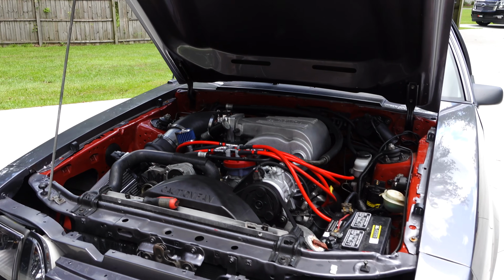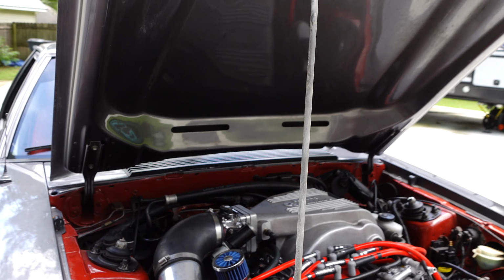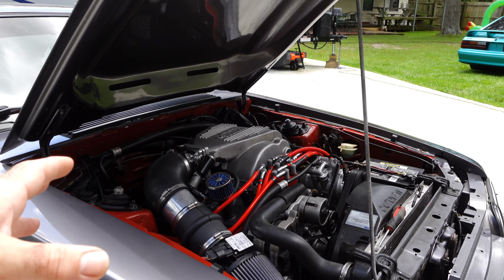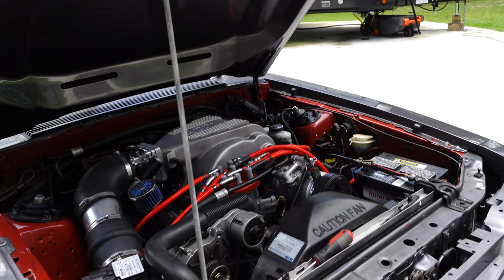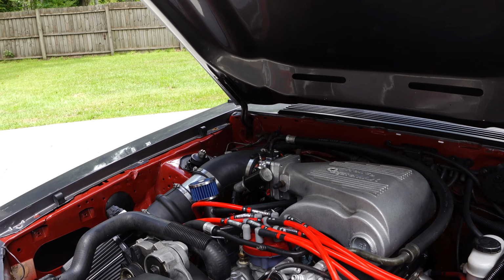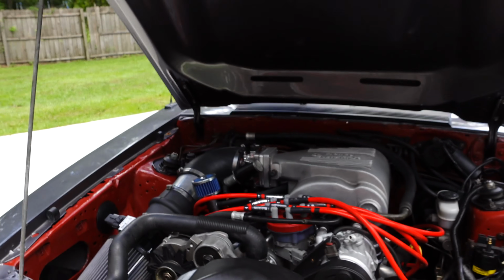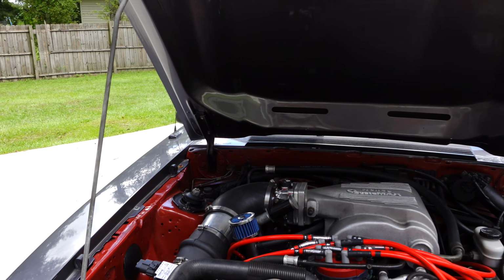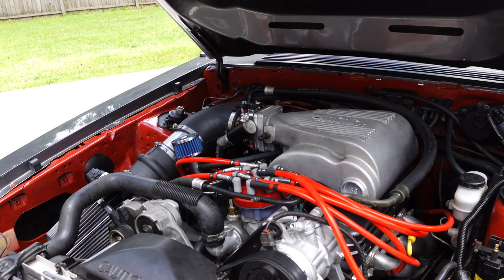Every once in a while I like to cover the build on this car because I know not everybody watches all the videos and this may be your first time. So I'll keep it quick. This is a 1968 302. It's got aftermarket pistons, old Canfield 192cc heads, Systemax upper and lower intake, 24-pound injectors, headers, 75mm AccuFab throttle body, and an Anderson N412 camshaft in it. I think that's pretty much it.